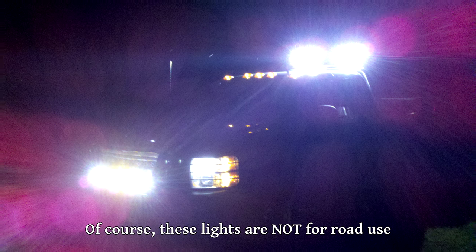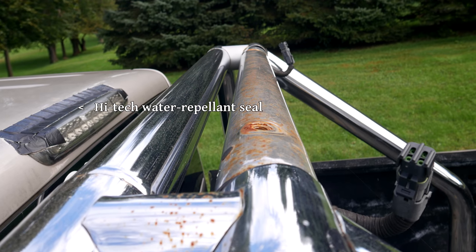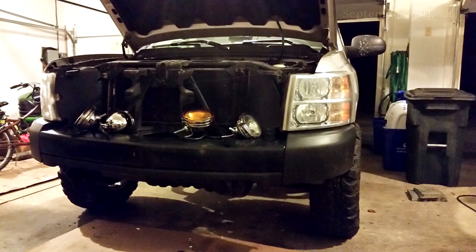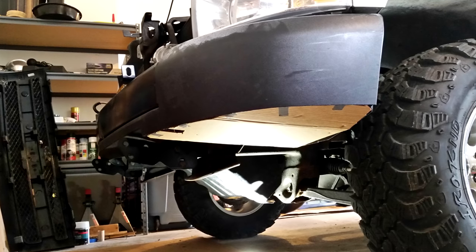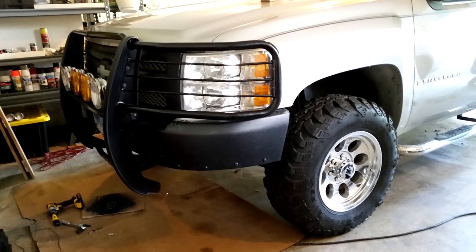Between the headlights, the four lights on the front, and the four lights on the back, this thing can put out a ridiculous amount of light. I ended up not putting any facing backwards because the lights up top are so bright they reflect off the roof and light up everything in a 30-foot radius around the truck. I also made sure to design the lights to be easily removable for times I might need to park in a garage. Over a few more months I continued to put the truck through its paces but eventually got sick of how bad the tires rub when turning and decided to cut a few inches off the bottom of the front bumper. It had cheap plastic trim and was a little damaged so I didn't feel too bad about it. I made cardboard templates and then cut pieces of sheet aluminum to bolt as covers beneath the bumpers to keep out excess mud and road debris.